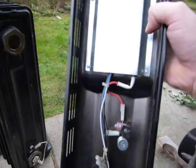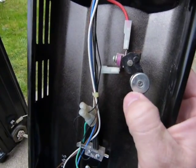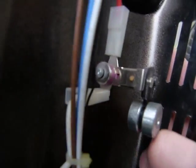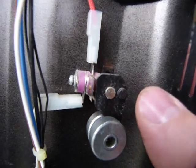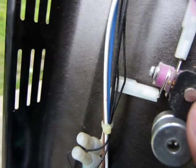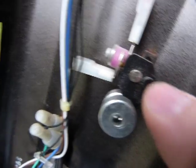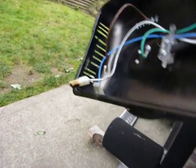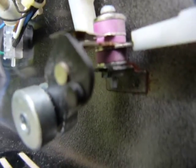If I flip this one around, you can see the tip-over sensor here — it's a metal blob that looks just about like so. It's dangling over a fulcrum point, and it's got a cam adjusted to it, which is this corner of this black plastic. When this heater tips over, this metal weight does this thing and forces these plates over.